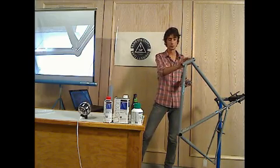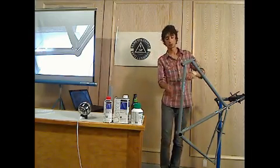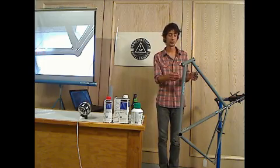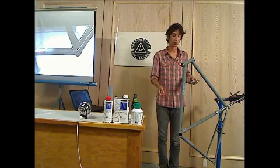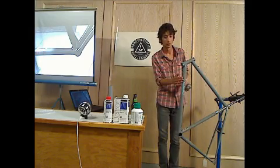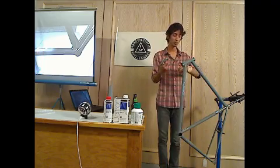So you'll always go over that anyway. With the color, if you have a problem, you just want to sand it out. Usually I'm blowing off after the first coat and I see some dust in there. You could just color it up with more color, depending on how bad it is. If it's really dark, I could just sand it out really lightly with some 800, once it's dry enough to sand, and then just keep going.